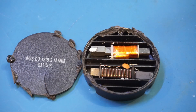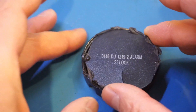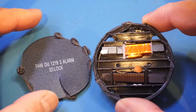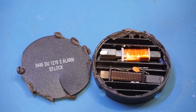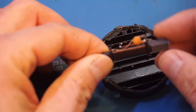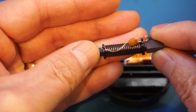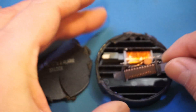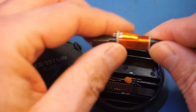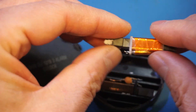Here's a look inside that puck. Originally I thought it must be some kind of RFID inside, but I guess it's actually much simpler. All it has are these two LC resonant passive devices. From the look of it, you can see that this LC device is resonating at a higher frequency because the inductor here is loosely wound, and the other one must have a much lower frequency as the inductor is densely wound. We also have what appears to be a higher value capacitor here.